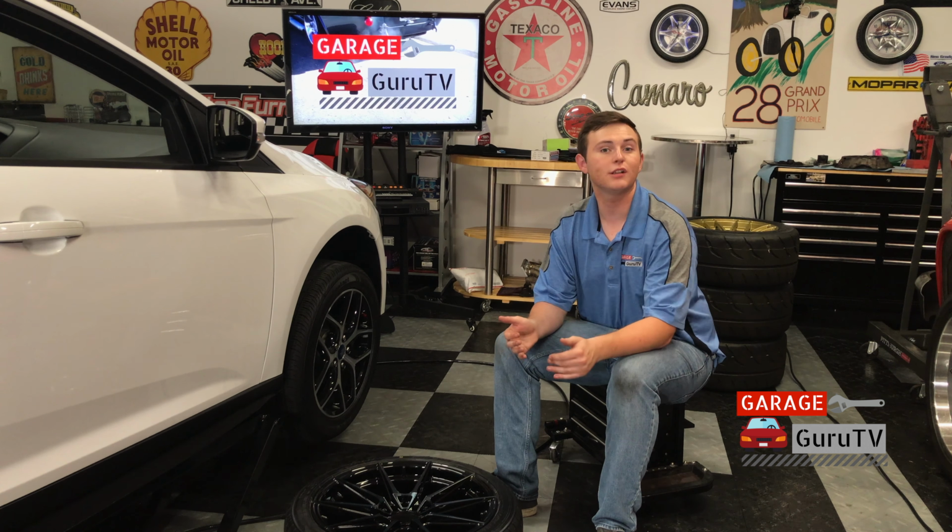All that math and calculating can be difficult and rack your brain, but the actual installation of new wheels and tires is extremely easy. Let me walk you through it. Prior to jacking your vehicle up, break loose your lug nuts, and then once in the air, remove the lug nuts, wheels, and in our case, wheel spacers.